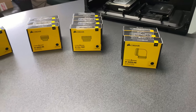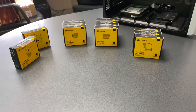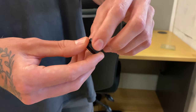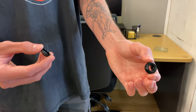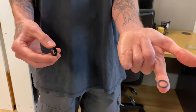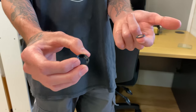Kit-wise, we'll be using these Corsair Hardline Compression Fittings. Compression fittings work by sliding your tube inside the fitting and then taking one of these O-rings along with one of these locking collars and screwing them together. This will act like a clamp, holding the tube inside the fitting and preventing any leaking.